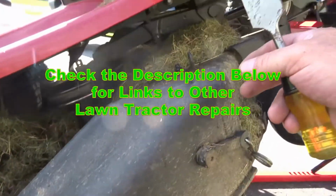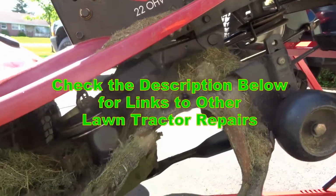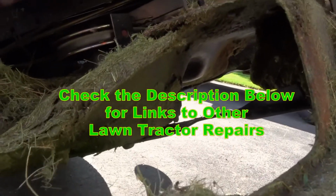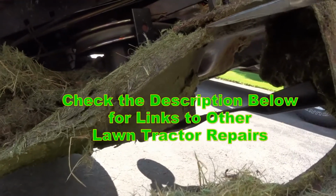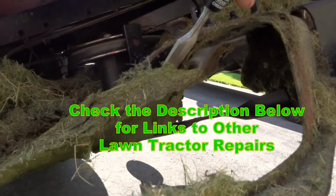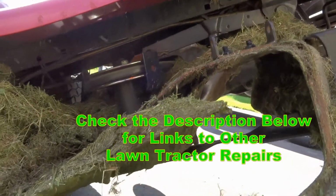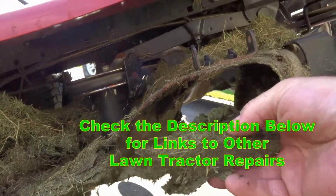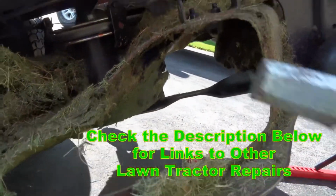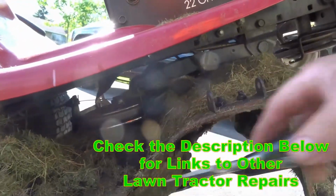Okay, just want to show you really quick here. So I mulch, so this is normally the exit chute. So I remove this. Now what I'm showing you here is just the minor amount of buildup here. It's worse underneath. I was looking, but for the sake of the video, it's tough to show you that. And this really interferes with how efficient the lawn tractor works. Like, there's stuff under there that's like this. So I'm going to go in under there, get this all cleaned out. I mean, that's just nasty.